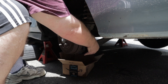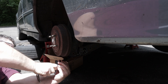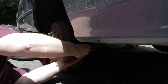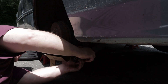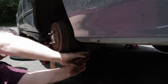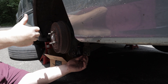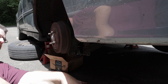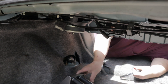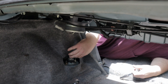Now we can just pop this down — you can get a pry bar. It's enough so you can just slide this over the edge. Now when you look at the orientation of this, right here on the back you have that — that's where your nut is welded. So when you put your other strut back in, make sure the welded nut is facing towards the driver's seat. Now in order to get to the top of the strut, I actually have a strut bar which I took off real quick. I've cut this out in order to install the strut bar.